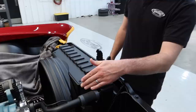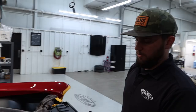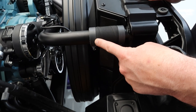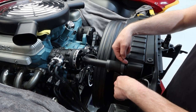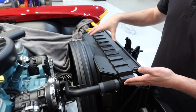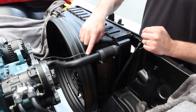We've got the radiator installed. Go back and forth depending on the car — sometimes we'll do rubber hoses upper and lower. This one, Josh fabricated a stainless steel upper hose with these nice short straight rubber sections. Heat shrink the clamps — just gives it that nice finished look. Every car calls for a different amount of detail and different components. A lot of times we'll put in the bleed fitting for the coolant passages. You'll have a crossover hose and this fitting will bleed air to the top of the radiator. Given how clean this overall package mimics the original style radiator and shroud, we didn't just want to run a fitting and a hose all the way up into that corner. So Josh did a real nice hard line that still gets to your highest point and follows the contour of the fabricated hose.